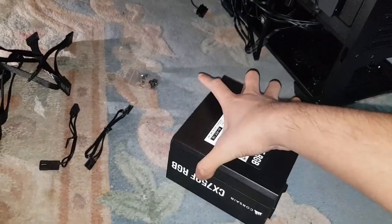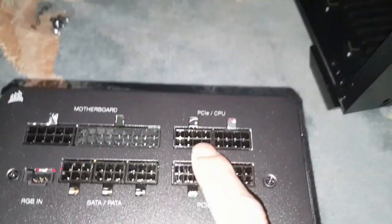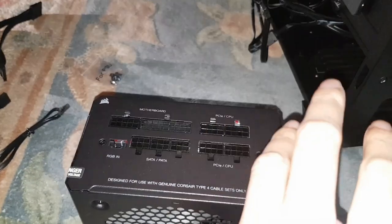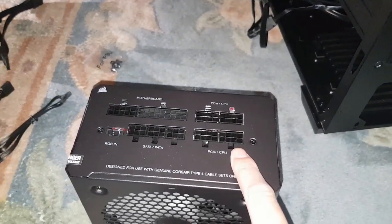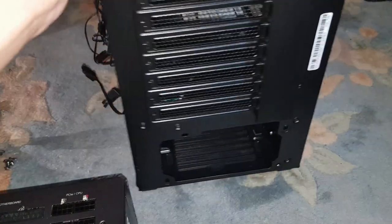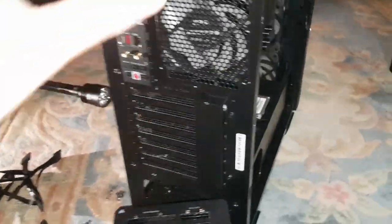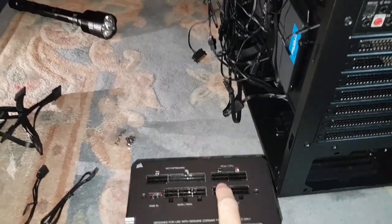That's the way I'm going to do it. Now let's see what wires we need to install. You're going to install anything that you're going to use. With my CPU, there are two CPU/PCIe ports — actually there are four. You need one for the graphics card, and you can do up to three CPUs. Some CPU-hungry motherboards, like E-ATX Extended ATX motherboards, use three CPU ports. Mine has two. If yours has two ports, make sure you plug in both, otherwise you might struggle with the power rating — I believe they give 150 watts each.